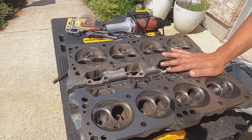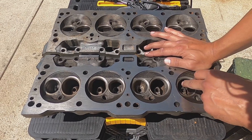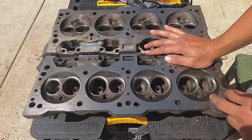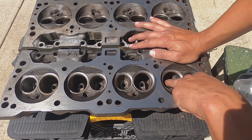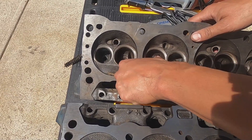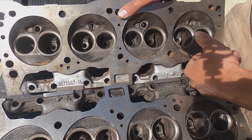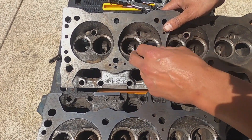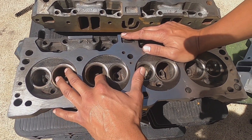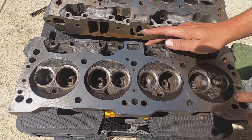A couple of things we want to do here. First - don't touch the seats. You do not want to mess with the seats; they are hardened, and if you start to nick it a little bit it sparks, which is one indicator you're going too far. What we want to do in the bowls is smooth out any hard points. These are very inconsistent in the original casting - if you look in here, the amount of step on one versus another is quite different, they're not very consistent. We want to knock off as much of that edge and smooth out any rough spots, mill away to be nice and smooth around the valve stem.